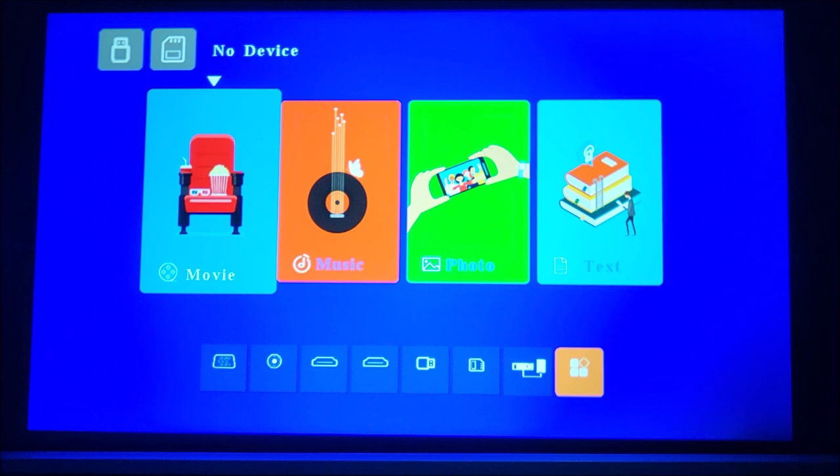I can understand why these LED projectors are less optically efficient than a DLP or a laser projector. So there's a lot of heat that it needs to get rid of. And I've seen some manufacturers with very quiet projectors, but I've read a lot of customer complaints that the LCDs degrade over time because of the high heat. And so it's sort of a trade-off. Either you have a quiet LCD projector with a very bright output, but it doesn't last as long because the heat buildup damages the LCD eventually, or you have one that's slightly louder like this, but at least it keeps the LCD panel a little bit cooler to extend the lifetime. It's sort of a trade-off.